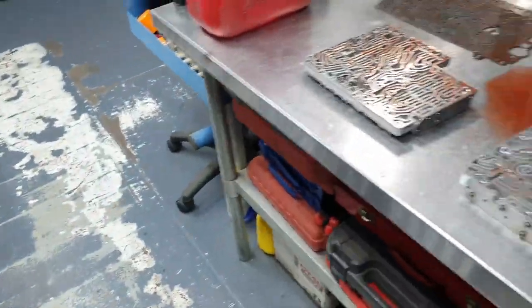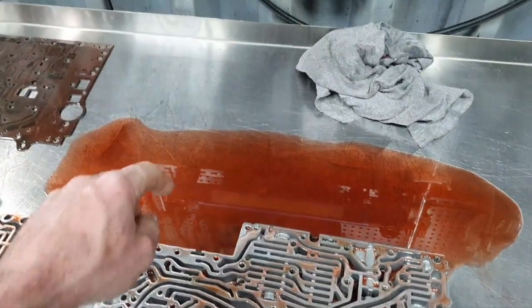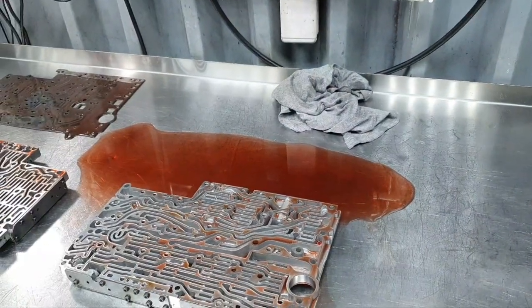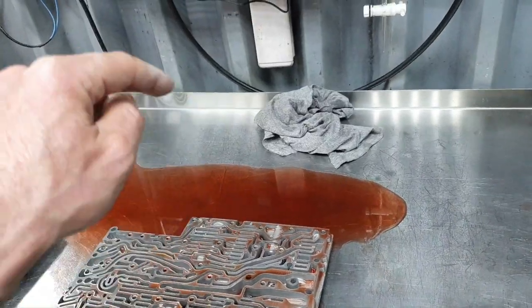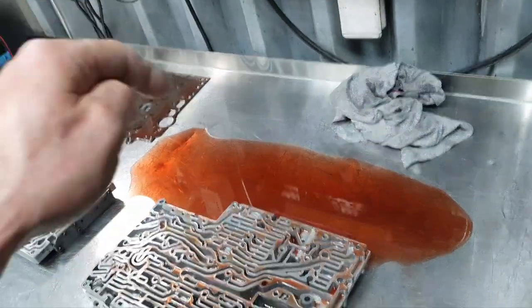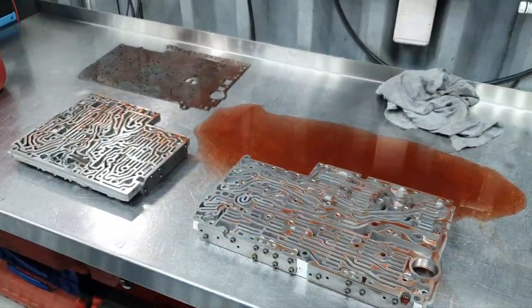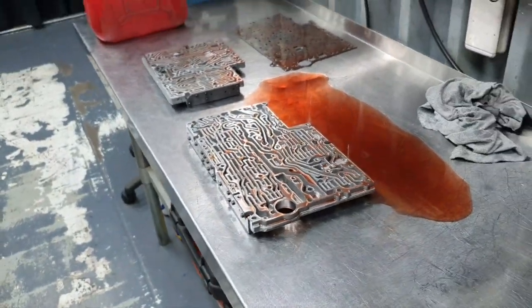Yeah. And I have at least another 20 cars that they're not running on a red fluid with a 722.6 transmission. I have mentioned that before. I'm not using the red one anymore. There is an announcement since 2010 to not use the red, the 236.14, and to use the 236.15. If you find it, then think about using the new generation fluid. Yeah. Stop talking, start working, right?